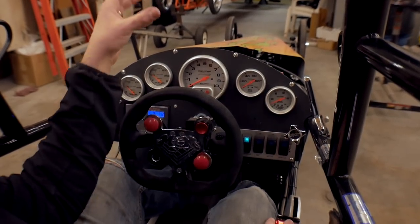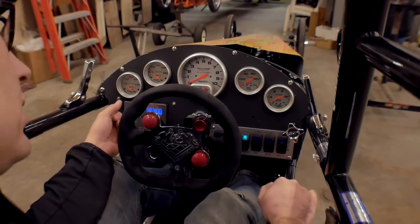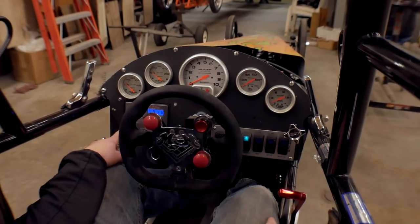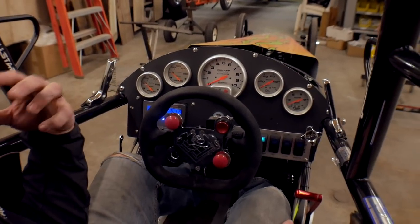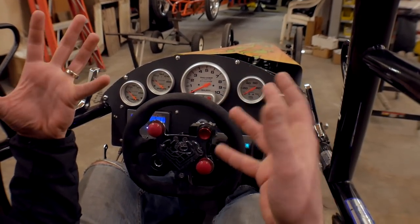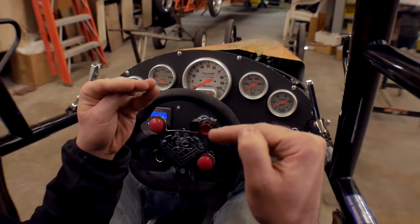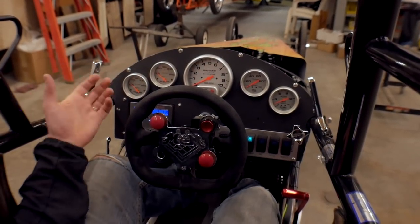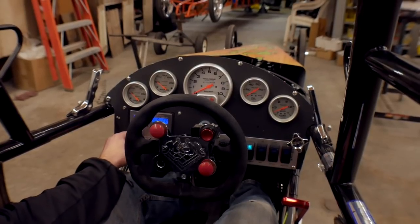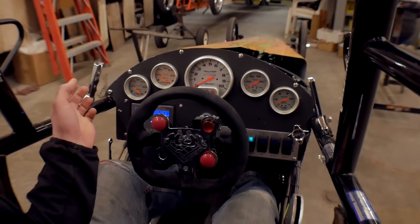I like to stop the car as quickly as possible after the burnout. I don't like to be rolling around on the track any more than I have to, for fear of getting any kind of contaminants on my tires. So after the burnout is complete, go ahead and go all the way up to park, then drop it back down into reverse. At this point, I'll click the trans brake button one time — the trans brake is now activated and the car is backing up in reverse. I barely, barely pass the starting line, because I just don't like to roll around on the track more than I have to. I hit the reset button so the car is not going to be backing up anymore, then drop it into low gear. Car is in low gear. Now I'm ready to stage the car.